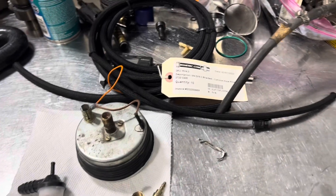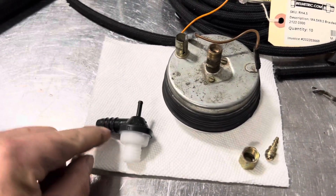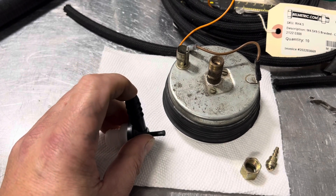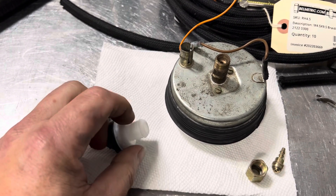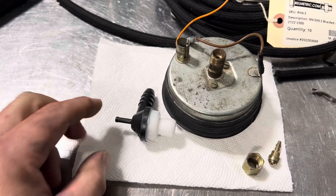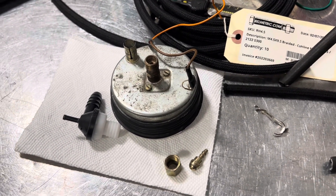We've got enough stuff to do a proof of concept. I'd ideally have another couple of feet of this — it's 3.5mm tubing. I have plenty of 4.5mm, so we'll do a proof of concept and make sure it works. The way this valve works: this is the side coming from the engine. When you have positive boost pressure, it'll go out this side but not that side — this is a check valve. When the engine's making vacuum, this check valve will allow the brake booster to see the vacuum, but not the pressure side. We're going to make sure we have enough air volume to actually make this ancient mechanical gauge work, and if it does, we'll get the right size hose and clamps.